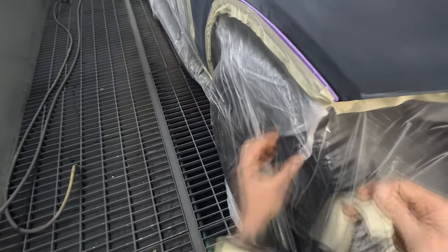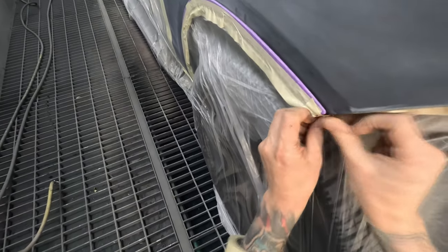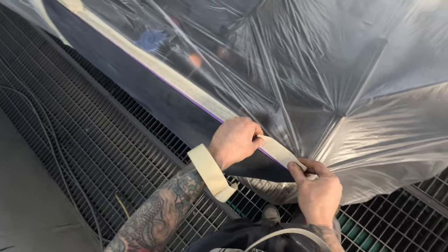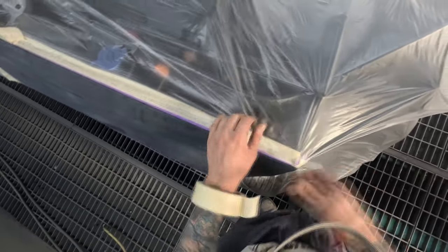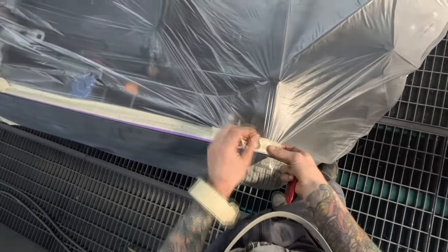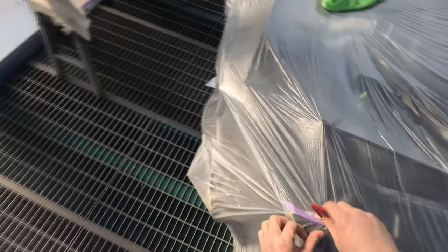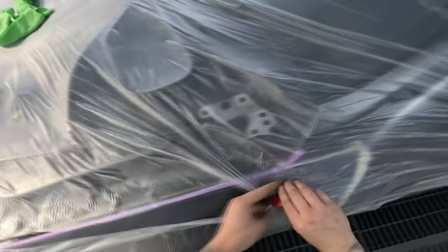And then I did a little Hyundai car yard job, right? It was a dark color. And I did all these different prep sections. I did one where I finish it off with 1500, one where I finish it off with my normal method, and all these different sections. And then one section where I put the base coat blender up to here, and then I stopped it halfway through the panel, and I found out that it was the base coat blender which was doing it.